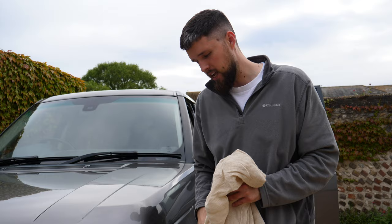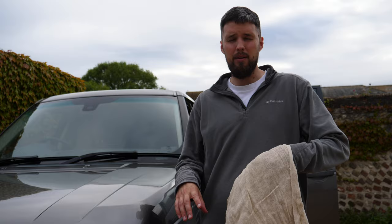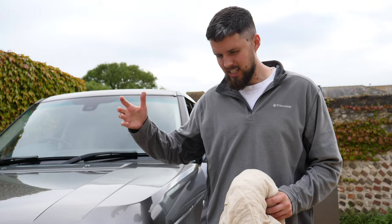Mainly because I watched a guy, I can't remember his channel, try and remove these and it took him 3 weeks in the end. He had to slowly drip feed the bolts with WD-40 over a number of weeks before they would even move. So I thought, let's skip that whole step and just spray them whilst they're still on the car.